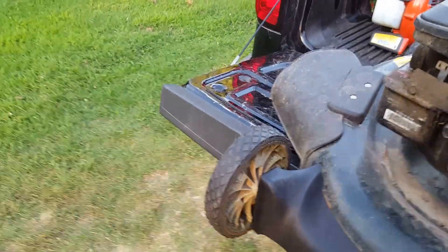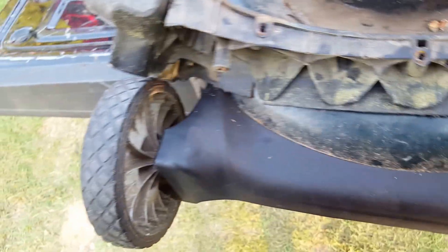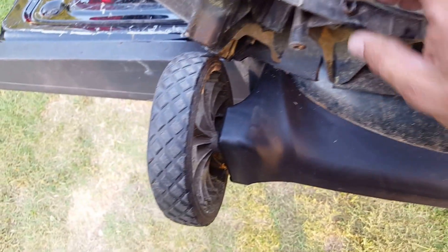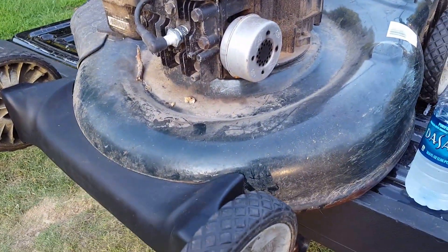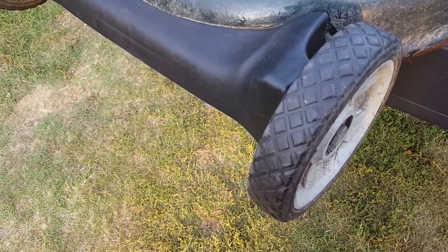All right, here it is. All I did was take these three screws out from the back side of the frame into this front bumper, and then there are two screws here and here that come up from the frame. Then I took the bolts that hold the wheels on, put them in that second slot, and replaced them back in there. I still don't know why they would use plastic to hold the front wheels on when the first thing we all do in thick grass is raise the mower and bang the front wheels on the ground — which is just going to break the plastic.